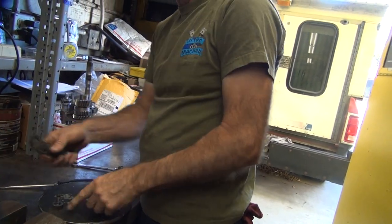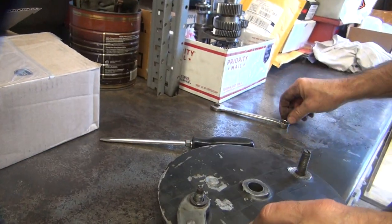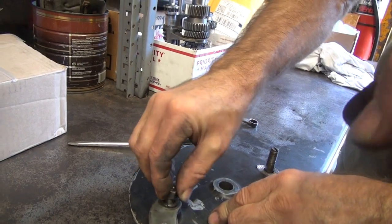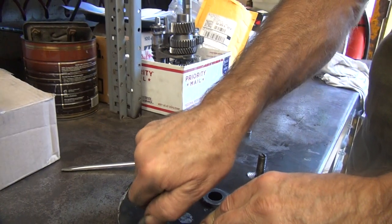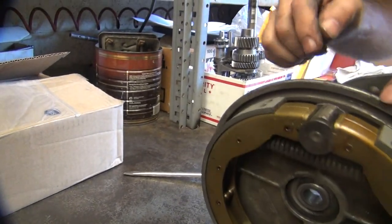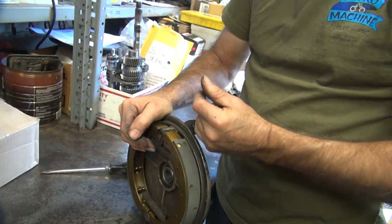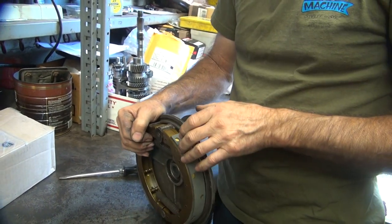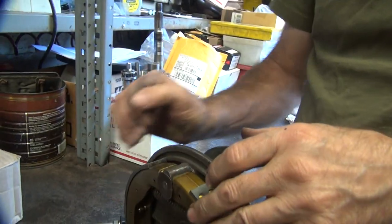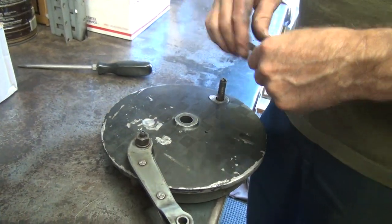Remember we had to extend the thing because we did a 4-inch. We had to expand. To extend. All right, and then what goes? I got a bolt that goes on. Big damn nut and washer goes over there somewhere. We had to grind the radius on the backside so that you could work this backwards. Normally there's a sharp edge right there. You know what happens when you don't do that? It locks the brake up and rips the whole thing out of the bottom. Yeah, but we did that already.